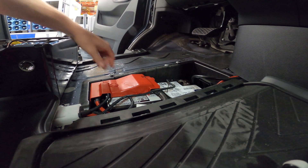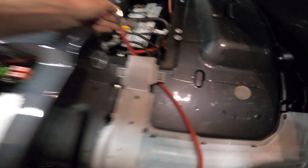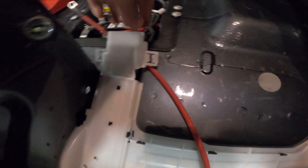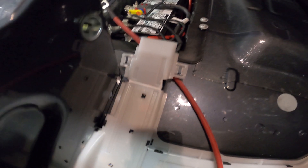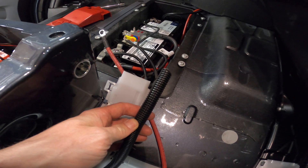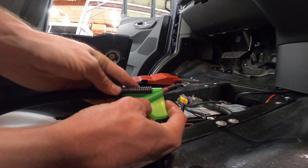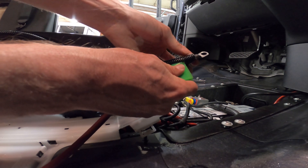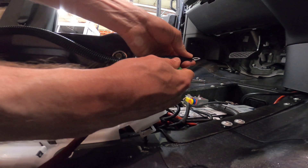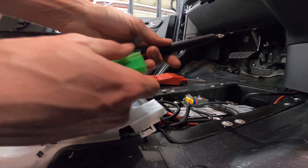And we can get to the battery. I made a small modification to this plastic piece here, and then I'm going to put some wire loom over it. This is actually very similar to what Mercedes uses — you can see in the seat they use the same thing. I 3D printed this tool to put the wire loom on, to hold the wire and the wire loom, and then just slide the tool and it puts the wire loom on for you.